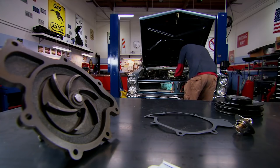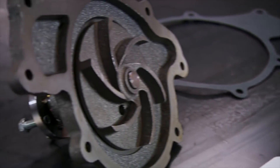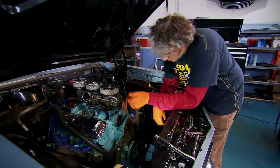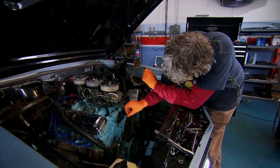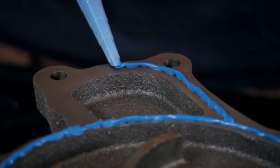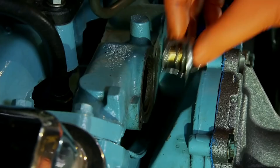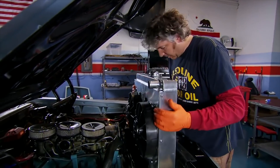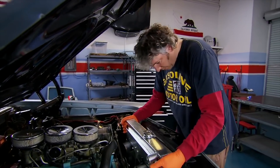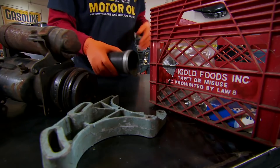That engineering fudge certainly points to this engine having a long-term heat issue. Next I want to be sure that sufficient coolant will be circulating to bring the engine temperature down, so I'm upgrading to a high performance water pump. I'm making sure the pump surface is absolutely super duper clean before putting the new pump and gasket in position. Whenever you're replacing a part that contains fluid always use a new gasket and sealant to keep it watertight. I'm ready to trial fit the lovely new radiator - it's looking good, but I can't complete the job until the air conditioning condenser has been reinstalled in front of the radiator, so I need to sort the aircon out before I can move on.